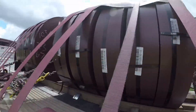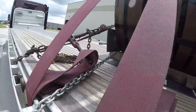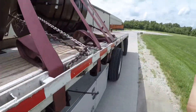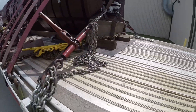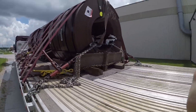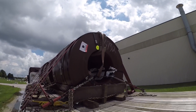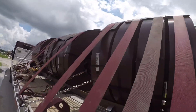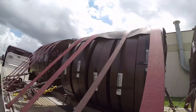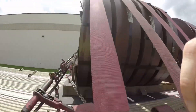That right there is probably the least dangerous one — the middle of the middle — that's why I elected to do that. I've got my H-blocks in there on both sections. My trip securement here and my trip securement right back here; I've still got to put a bungee on those to hold everything tight. Right up here I've got a 12 o'clock strap — using my felt edge protection to protect it, ratchet's on top of all that.